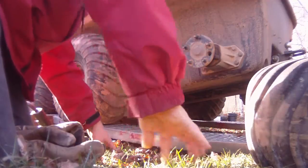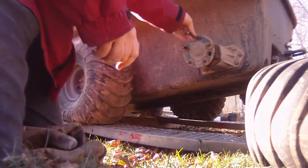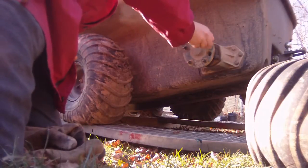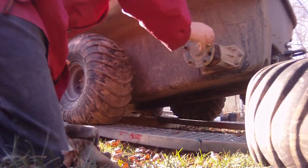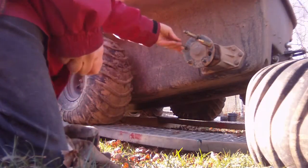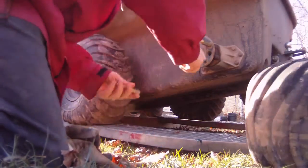So there it is. You just take your wheel extensions and thread them on. Make sure they thread on fairly easy. You don't want to go on cross-threaded. And you're going to put them all the way in. Okay, some of these will start in and they'll bind a bit, but it could be because of your wheel nuts through the summer getting dirt on them. And we didn't take a wire brush and clean these threads, we just took them off. So, we'll put these on real quick.